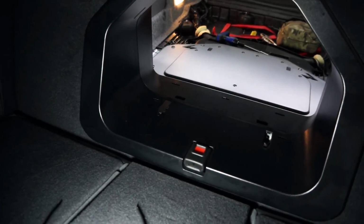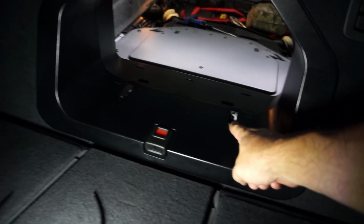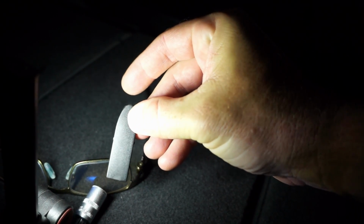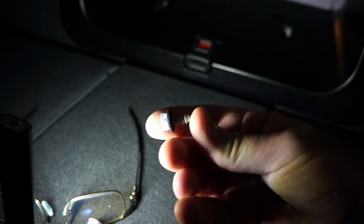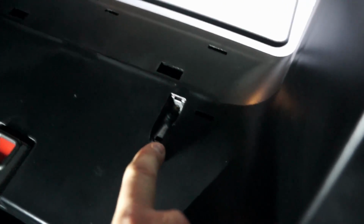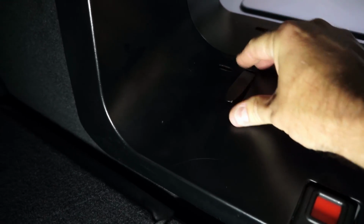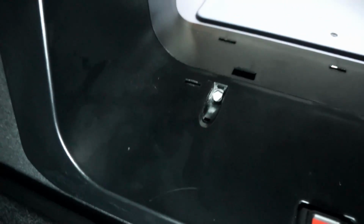Okay, on the inside, this might be difficult to see, but there's 2 clips or 2 covers. They look like this, and they're plastic, and they cover these bolts, bolts that look like this. These are 10mm. To get to them, you have to pry off this piece of plastic, the plastic that goes right here. Here's the other one that's nearly on, but you stick something really tiny underneath the front and you pry it up. Then it comes off and you can access the bolt underneath.